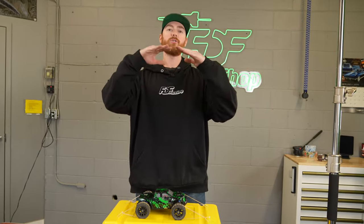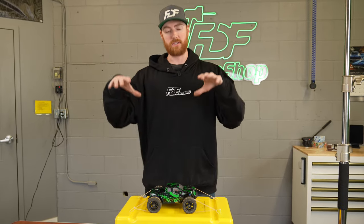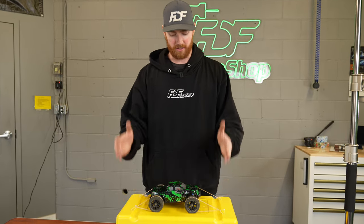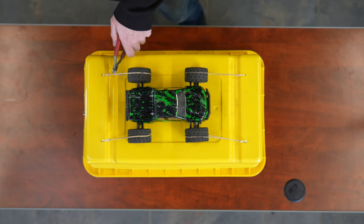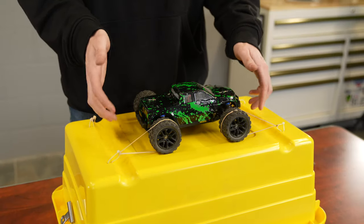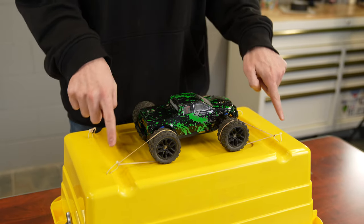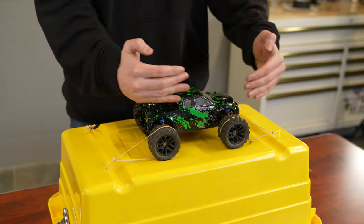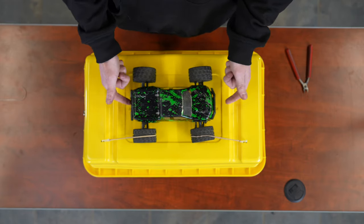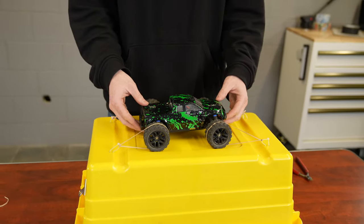Whereas if you connect to the chassis, those straps will tension and slack as the car bounces because the suspension is being pulled down by the strap. You hit a bump, the suspension compresses, and the strap loosens. Wheels to trailer is the best setup. If I simulate cutting one strap, we'll lose some tension and have a slight shift over bumps — but the settled position is significantly better, with two opposing forces keeping the car centered. You could actually get away with only two straps, because they oppose each other. The car may move slightly side to side, but it's unlikely due to tire friction, and it's still constrained forward and back for braking and accelerating. This is the best way.